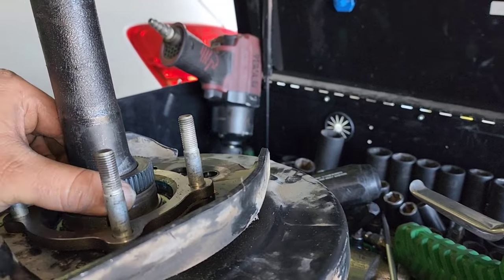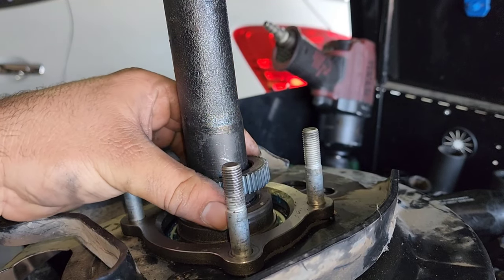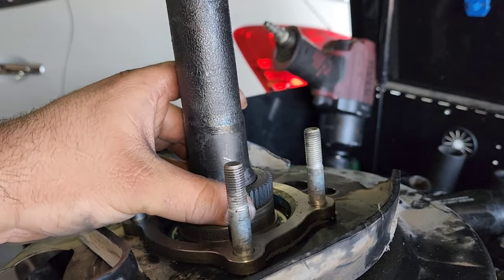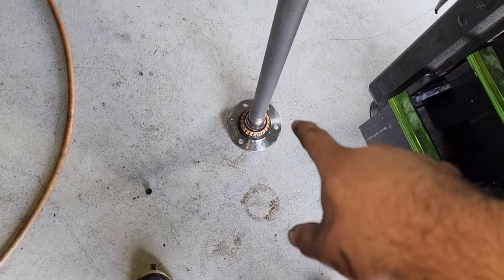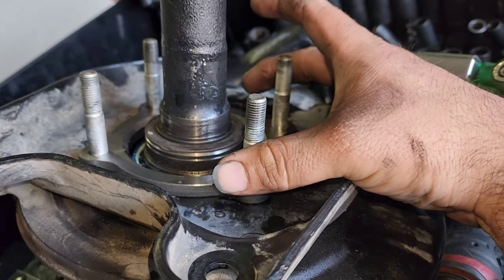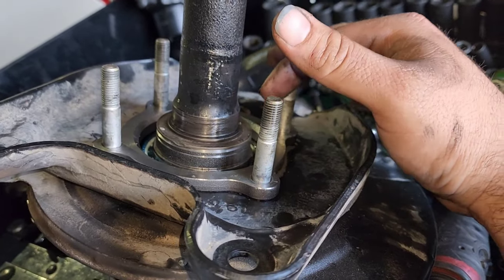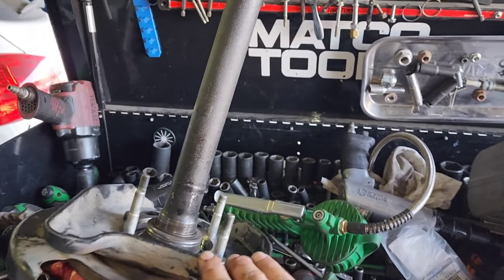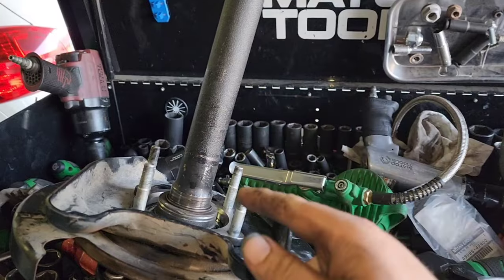My reluctor wheel is just coming off — what the freak? That's not supposed to happen. Look at how it just freewheels. That is a no bueno. We tried putting it on the old one and it does the same thing, so there can only be one possible thing — that ABS exciter ring, the reluctor wheel, it's not agreeing with this vehicle or this axle, meaning it was manufactured wrong. So that being said, I gotta wait until tomorrow to get a new one. Please check these videos out, subscribe, join the FM fam down below, and I will update y'all in another video. Deuce.